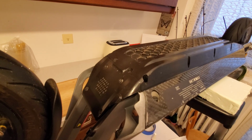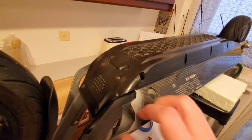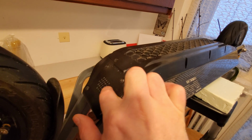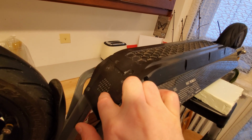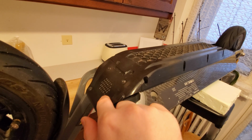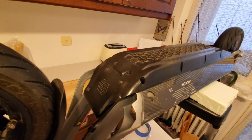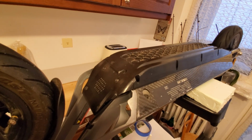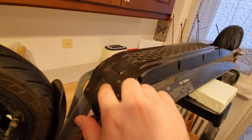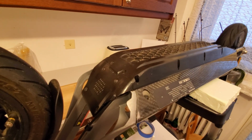In case you notice the performance of your horn has decreased quite a bit, that can happen when the front cavity is filled with dirt, especially when you ride in wet conditions and the dirt that accumulates under this cover gets wet. That can create a barrier between the horn and the outside, and it can muffle the sound of the horn.